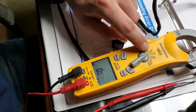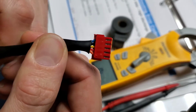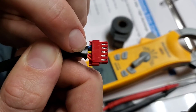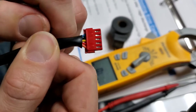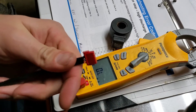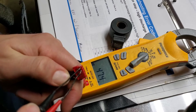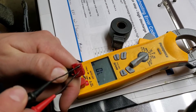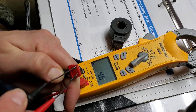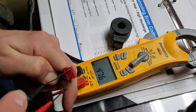I have my meter set to ohms — there's the display so you can see the readout, and this right here is the plug. We're going to check from the blue wire, which is your common, to your black, your yellow, your orange, and your red. We're going to read out 46 ohms. Watch the display as I go through the readings: blue to black — 47, that's a good read. Blue to yellow — 47, that's a good read. Blue to red — 4.6, that's not a good read. Let's go on to blue to orange.